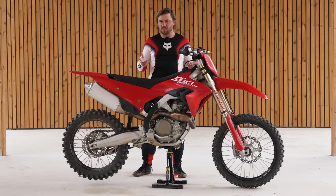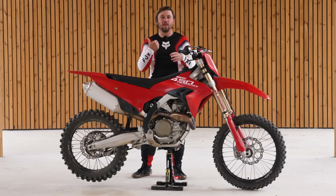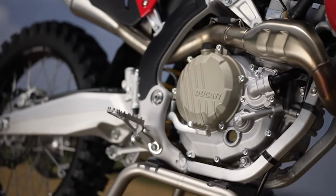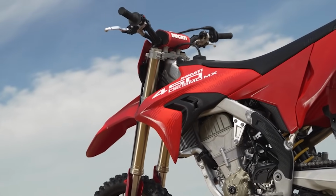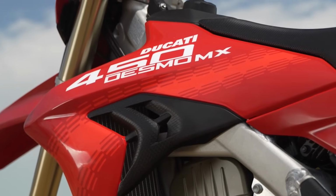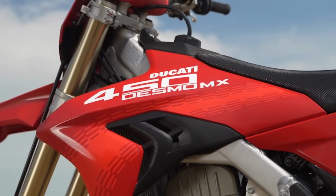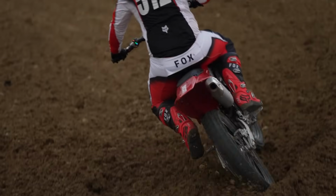What are the advantages? Two things. One, less friction than a cam slapping basically a bucket and trying to compress a spring. That motion creates more friction in the engine than this setup. Also, by controlling the valve not only on the opening, but the closing with basically a finger follower or a follower arm, it allows for better control at high RPMs. I mean, they've got Superbikes and MotoGP setups that can spin, I think, upwards of 18, almost 20,000 RPM with this style of setup. We're not quite that crazy here with the 450, of course, but it does allow for much better control at high RPM.